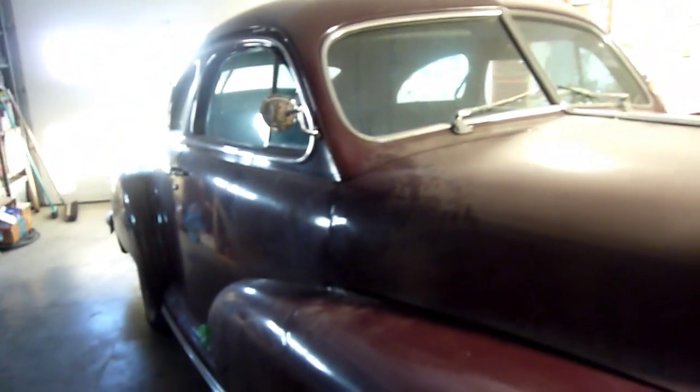On this one, I found I could not move the fender far enough forward to get a good line between these two — it's back just a little bit too far. The wing is going to be very tight. By loosening that bolt it actually allows the fender to come more forward; it was pulling everything back. I think what was happening is it was binding in here — the center fender was hitting the front strut and not allowing anything to come forward.